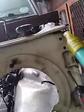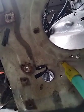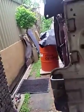So he has drilled through the area. He will do spot welding through these. You can see these through holes, right, and it will secure this part to the vehicle. So you can see the holes drilled here. Through the holes only he will put the filling material while he is doing the welding. And now he's doing the aligning. So this is the first fixing to see that everything is perfect before doing the final welding. So this is the first day of what he has done.